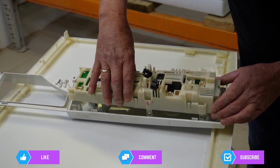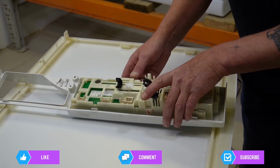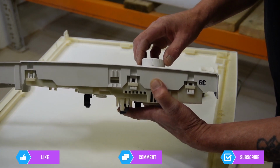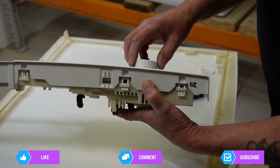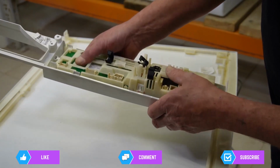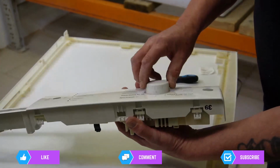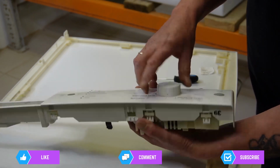It's very important that you do not force it. You line it up first and just rest it. Then with your hand, rotate it over, softly push, just softly. I can feel the knob is located onto the actual circuit board. Once you've done that, you're then able to push this down so that all the tabs lock in place. It is a very delicate process, but do take your time to do that. And that knob now is turning the program to the correct point.